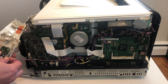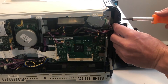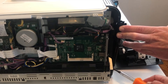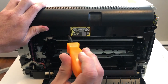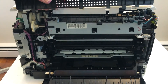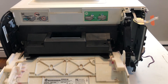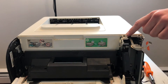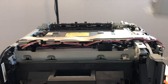This is the HP CP-1525NW — these are the typical types of things you'll need to do to get access to the laser and mirror assembly on your printer. Be careful when you pry each piece off that you don't break the plastic. Taking off the back cover panel, there's one more screw to get the top cover panel off. Now that that's removed, we can take the top cover panel off — and there is the laser mirror assembly for this printer.